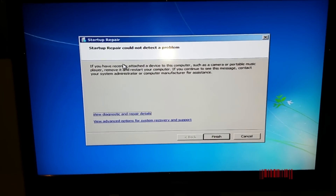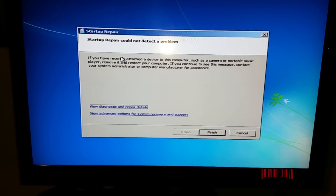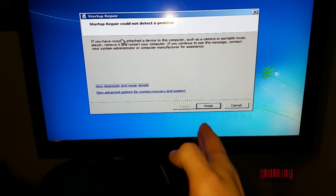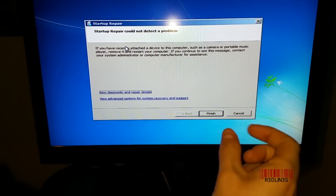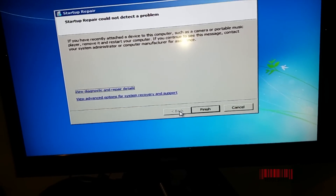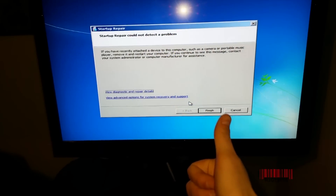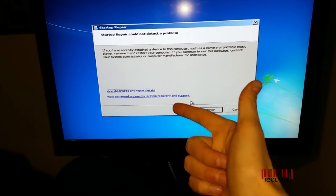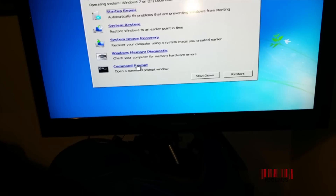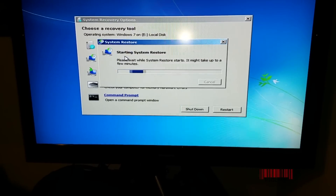This message is telling me that everything's fine, because the system actually boots. It's after it's booted that it starts to load Windows, and that's where our problem is — after the boot sequence. So the next thing to do if Safe Mode doesn't work and Repair Boot Sequence doesn't work is, hopefully you have System Restore activated, so we are going to go to System Restore.